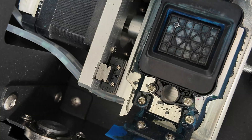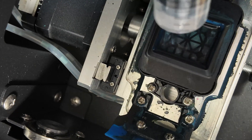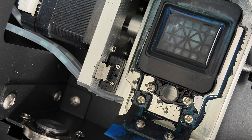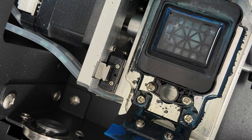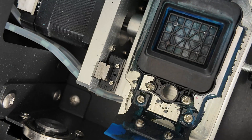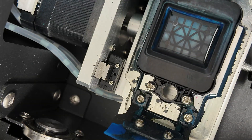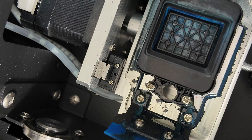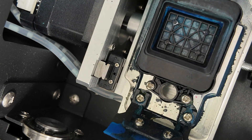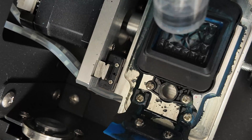I kind of hooked the camera there to show you. So just feel that all the way in, and when you suck from the end of the waste tube with the other one, that's what happens. And that's how you are cleaning the pad to make sure it's not holding any dry ink. Let's add a little bit more — now it's coming light gray. This was super dark, and this is for one week of imprinting.